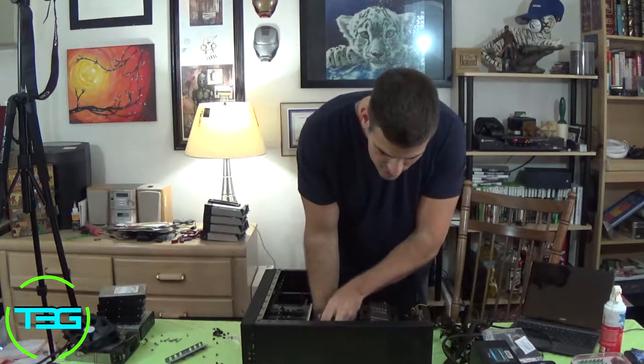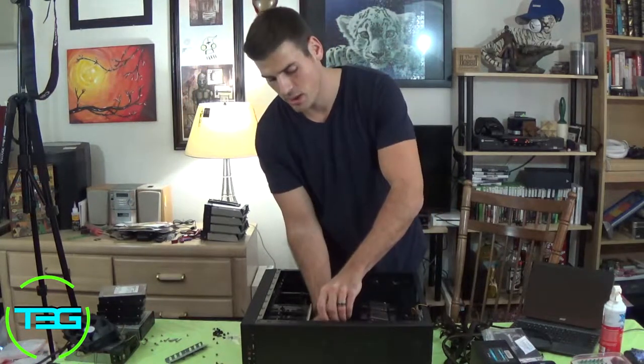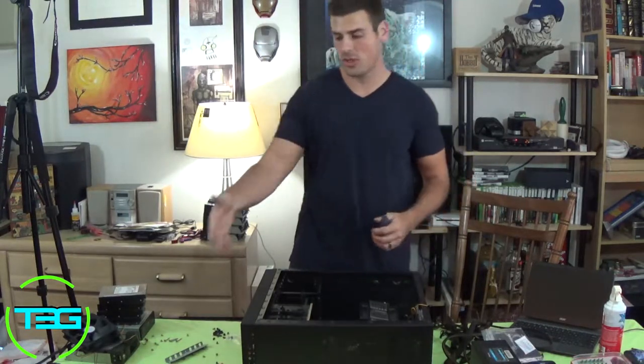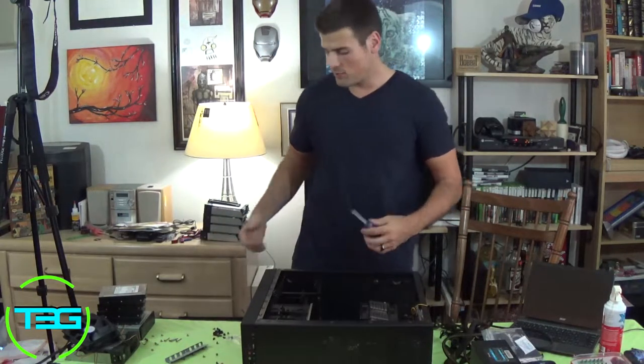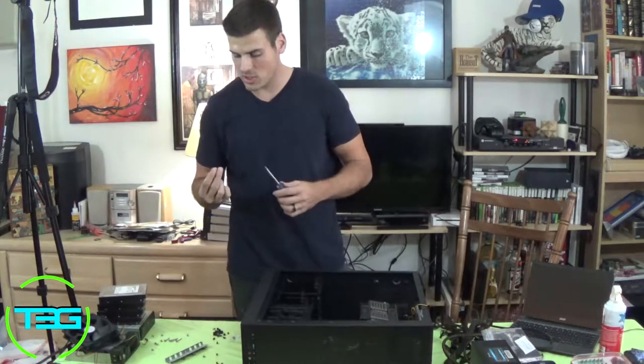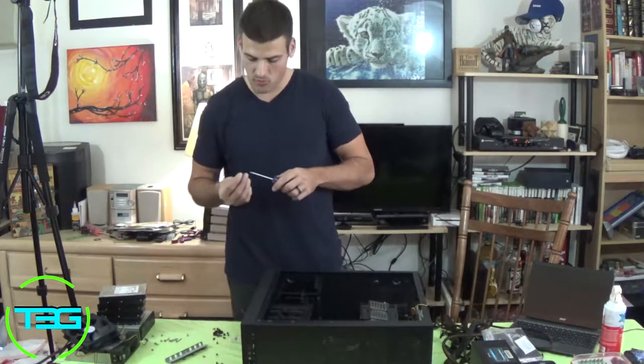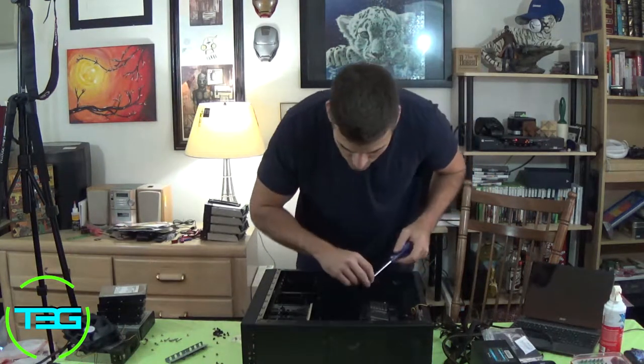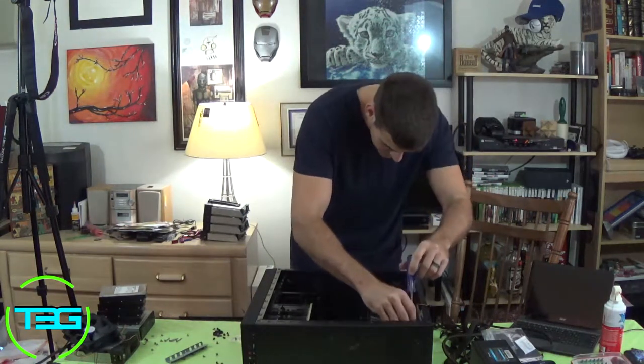I mean, I'm paying attention. I'm making sure I'm touching metal stuff before I touch the motherboard. Because you don't want to shock the board or anything that has a board, like the graphics card, the motherboard. If you do shock it from the static electricity, you're most likely going to fry the board. And yeah, basically that's it. You're going to have to pick up a new one. So we got one last screw, and it's in the worst spot.